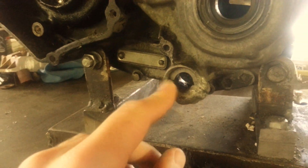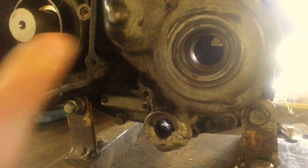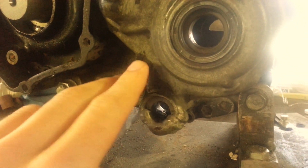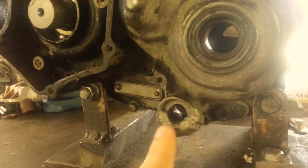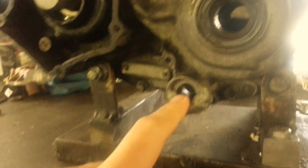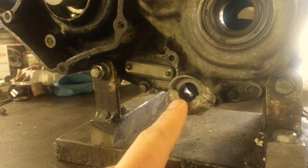Another thing — probably seen it in the past video — but this case was messed up here at the shifter shaft, which is an uncommon failure: when the chain derails and pops down, it breaks this area — you can see it's broke off. The clutch boss area is actually pretty decent though, and I have repaired these in the past. I did a set of CR500 cases one time and it turned out fairly well.